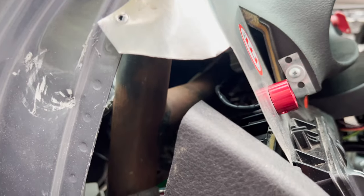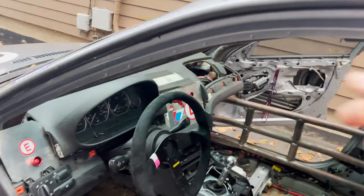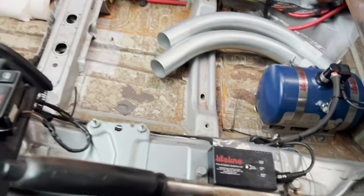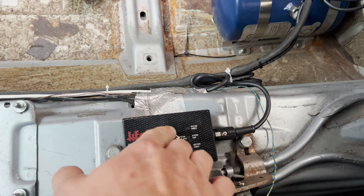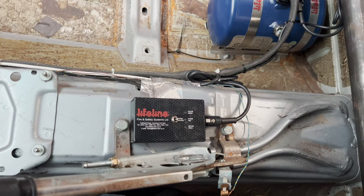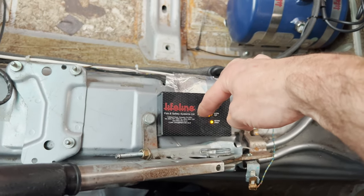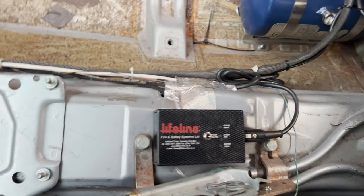We managed to hook them up, and that's really the one complaint I have about this system's wiring. Once wired, it's pretty straightforward. Looking at the brain box — it has a toggle switch with three settings. There's a battery check mode: this system runs on its own internal battery, independent from the car, so you need to check it periodically — probably yearly or every two years. You just press this button and if the light comes on, the system is good.